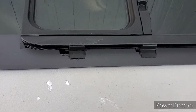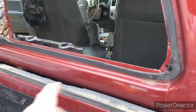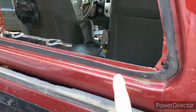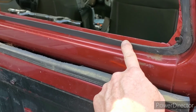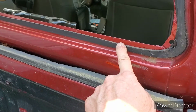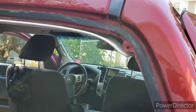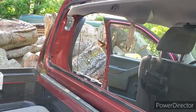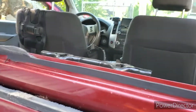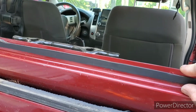So I know when you watch the videos, it seems like some people debate whether or not the adhesive should go on the window or on the vehicle frame. I would definitely say the vehicle frame, to make sure that you are going to have a good bead sealing all the way around the way it's supposed to, because that's actually a fairly narrow channel to land on correctly.